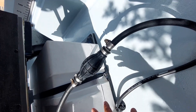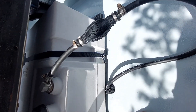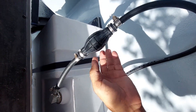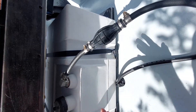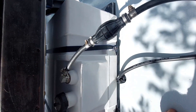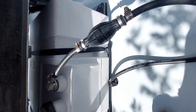So I'm going to be removing it and just putting the hose straight to the tank. Something I wanted to share because in my video of installing the tank I did go ahead and put the primer bulb — it's how I've done it on all my previous boats. But with newer engines that's one less thing you need to worry about, since these things do go bad. It's a good thing knowing I won't be needing it.